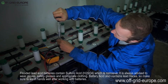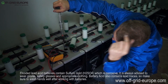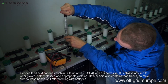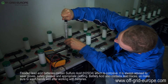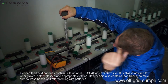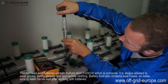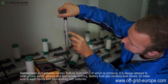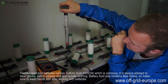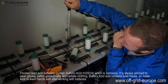So we're going to do a measurement here by getting the sulfuric acid up. As you can see we've got just a little bit of buoyancy going here. Let me just give it another go and get a little bit more liquid in. There we go — it's floating, as you can see, just above the bottom. The sulfuric acid level is just below 1.19. So this battery is about 50% depth of discharge and definitely in need of a good charge.